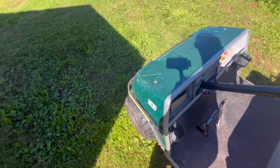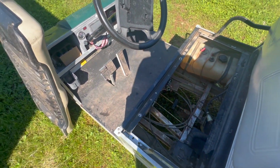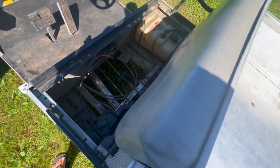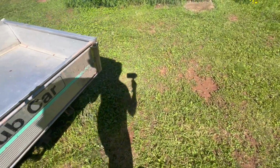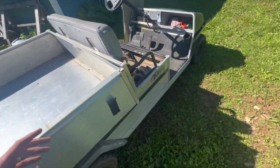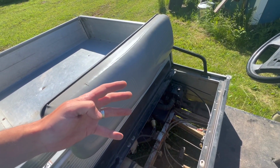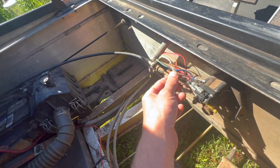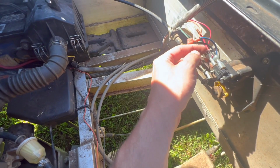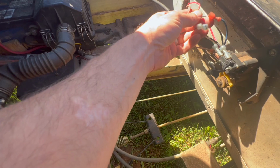So there's a history with this machine too. The customer's initial concern was that they had this in at a different repair shop, I think he said last year, for a no-start condition. And when they brought it in, the shop diagnosed the 4 limit switches as bad, and so they bypassed them. I don't think that they bypassed them all, because it looks like this one here is still activated, but they removed, you know, a bunch of switches.